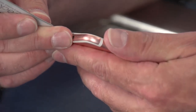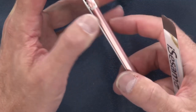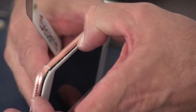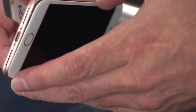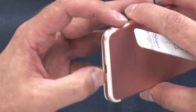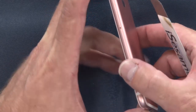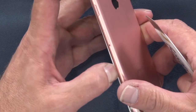Entry point here and carefully pry. I have had this one apart so if you're doing a repair on your iPhone 7 it will battle you quite a bit more than this one is battling me. I'm carefully working around the adhesive — you don't want to force this up or you will crack your screen.